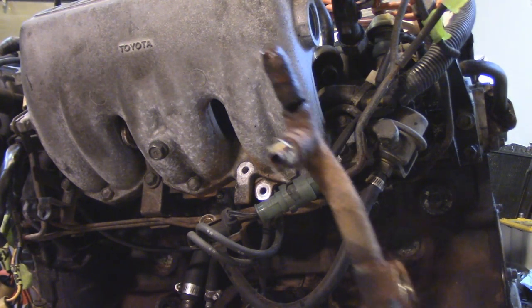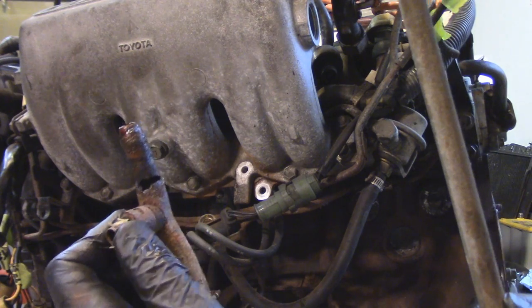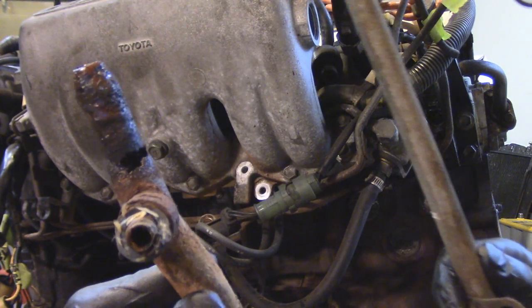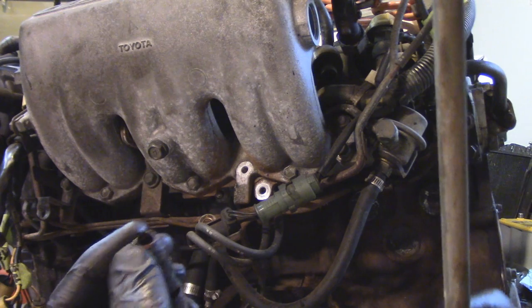It's worth noting this car is old enough that it's possible there was still methanol-based coolant in it, and that really accelerated the corrosion on metal parts like this. Anymore, we use the glycol formulas that don't seem to corrode quite as bad, so hopefully this won't be as much of an issue, but it still may be an issue in the future.